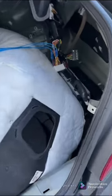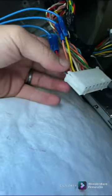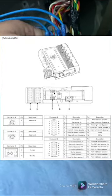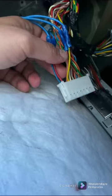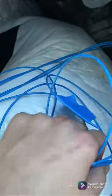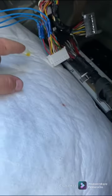All right, so I have the amp now tapped into the factory harness. I will provide a wiring diagram in the video, or if not, I'll provide a link to it in the description. Basically, I tapped off of left and right, positive, negative, 4 wires, and they're all labeled. So just put some tape on it, label it, whatever, so that when you run it, you know which is which. This is going to go to a line out converter. Now you can put your line out converter back here if you want, and then just run your RCAs out.